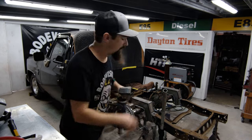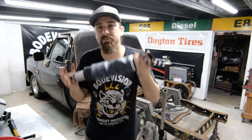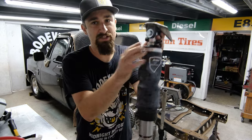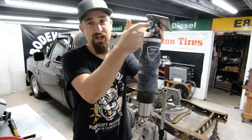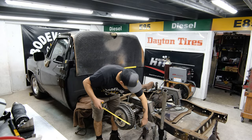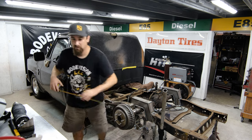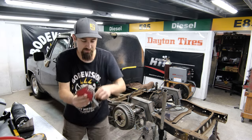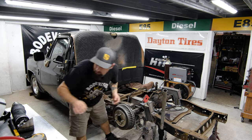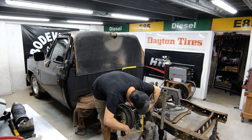There is some important information that I need to know. Right now the axle is up as high as it will ever be, meaning the truck is sitting as low as it will ever be. So I need to know what my maximum compressed length is going to be for my shocks. For this one it's about 11 and a half inches — that's eyelet to eyelet, roughly 11 inches. Where I have the top mounted and where I have the bottom mounted needs to be roughly 11 inches. Right now it is about 11 inches away, so from the top of this bolt to the top of that bolt is right on.